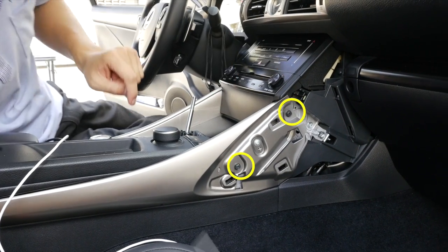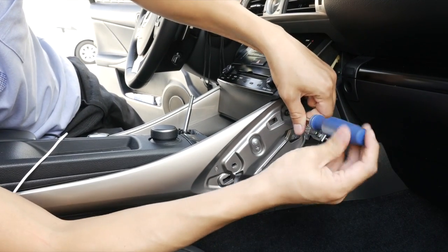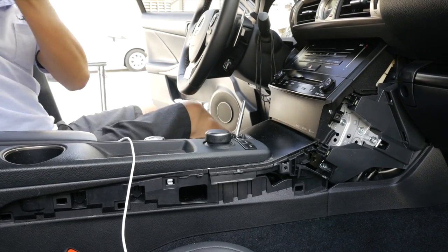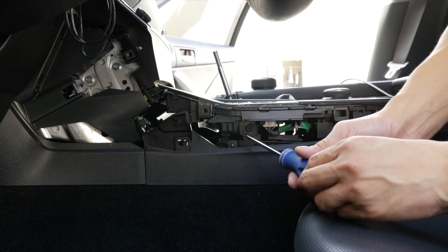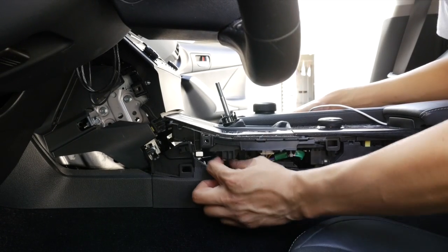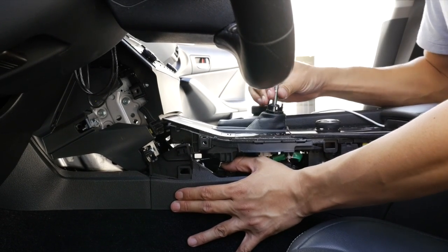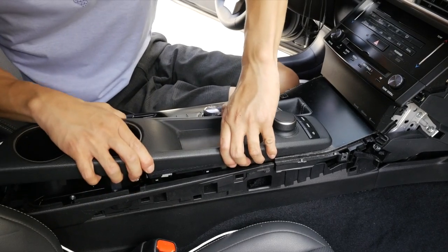The next step is to remove these screws using a Phillips screwdriver by turning counterclockwise. Once you have that removed, just gently pull it out. And do the same for the other side. This Phillips screwdriver screw is only on the driver's side, so remember if you look from the passenger side it's not there. Once the screw is removed, stick your hand in and you'll feel a shift lever lock. Press that button down and while holding it, change your gear to neutral or drive. Then raise your armrest and gently pull the center piece up.